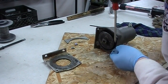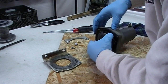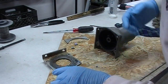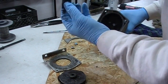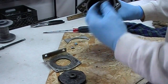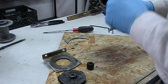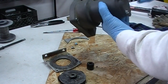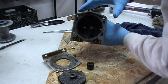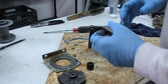Here's the first planetary gear and it's got some pretty crusty grease on it — I'll clean that up in gasoline also. Looking inside there's another gear, and it was in with the flat side down. It just goes onto a spindle in there with a flat side, so it can only go on one way. I'll clean up the inside of this and regrease it. Last year when I took the motor apart, these bolts here are really long — they go all the way through and that's what holds the motor to the gearbox. I'm not going to get into the motor this year; it seems to be fine. It's just the grinding noise I'm trying to address. I'll clean this up and then put it back together and hopefully it works when I'm done.